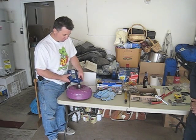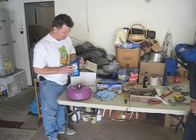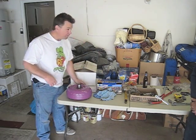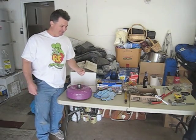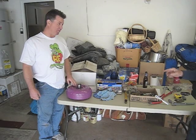But as I read further, they said the newer version of it is this Mercon V, Mercon 5. Yeah, alright. Cool. Improved. Do we put this back on? Nope. What would happen if we put that back on? You couldn't. The input shaft has to slip through that hole. Now we have to be careful not to spill this out of here, huh?